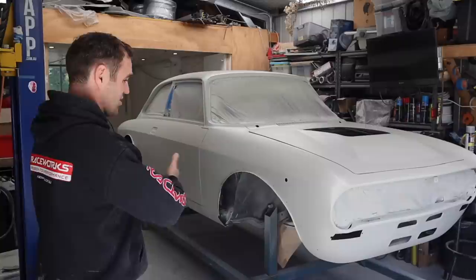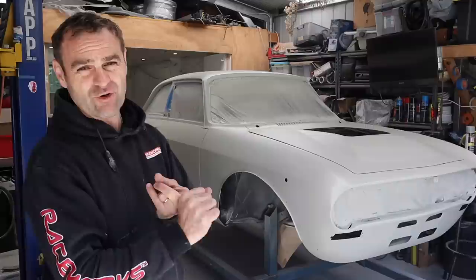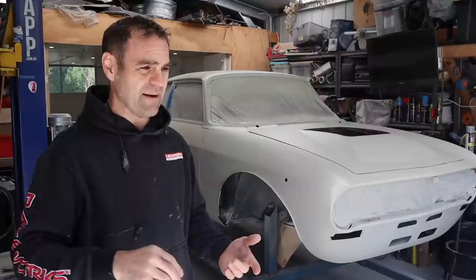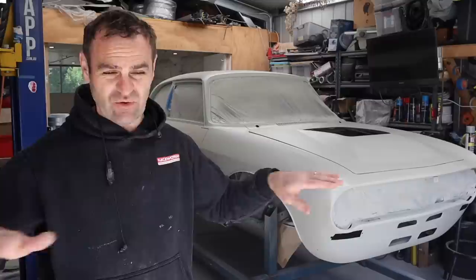The first thing is I've got to start sanding back this last coat of high-fill primer, starting with the engine bay — so removing the bonnet and tidying it up. I need to get it back down to 400 grit sandpaper. 400 grit is fine enough; you don't want to go too fine when sanding back primer. Some people go 800 grit but the trouble is you're almost polishing the surface and there's no tooth for the paint to stick. With 400 grit you will not see any scratches — it will easily be covered.